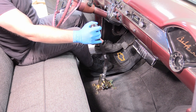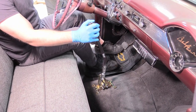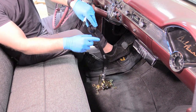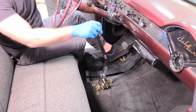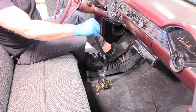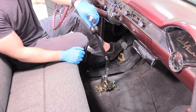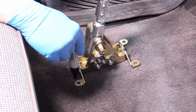Make sure you can move your seat forward and back depending on the different drivers. Mine's in the perfect position. Keep in mind the sweep of the gears as well — is this going to hit the seat or center console or whatever you have? So you want to be mindful of that. Since this is a full manual valve body, I really want it to be comfortable to hand as well. Take your time. I think right here is very excellent, and I can mark that down.